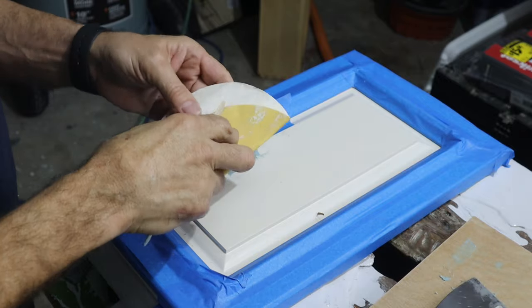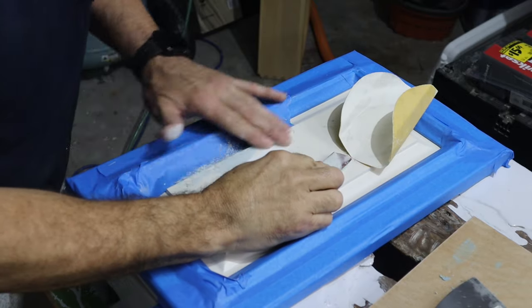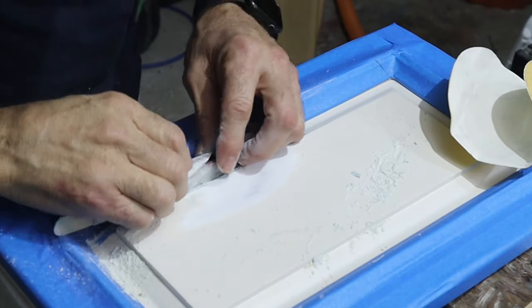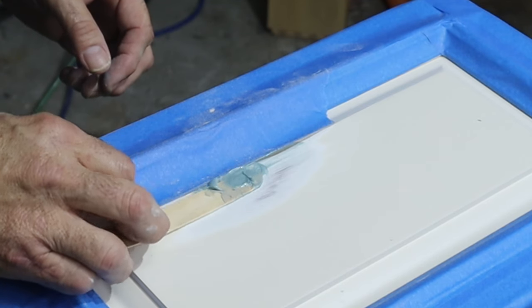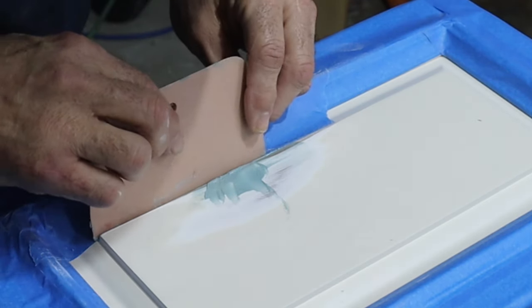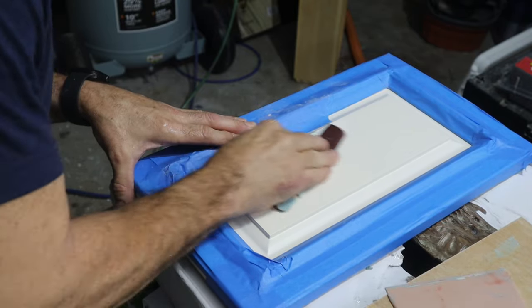I let it dry for a few minutes and came back with sandpaper and a small stick. I tried to use 220 to knock it down but it didn't work, so I went back to 120-grit sandpaper to knock the body filler down. Make sure to clean up the edge before starting another layer of Bondo. It's looking good but not exactly where we want it, so we'll fill a little more of the gaps — there's a tiny dip. Then come back over with the side to keep the edge sharp so we have minimal sanding for the last pass.